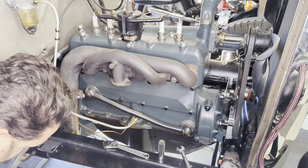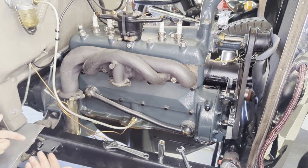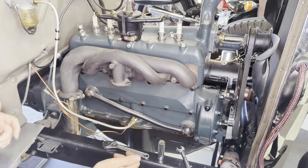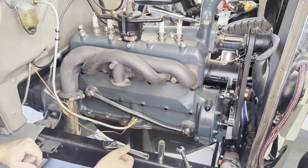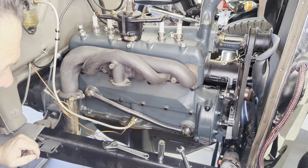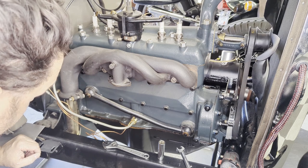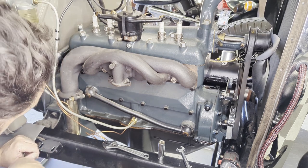I do think it's a good carburetor overall. I put new jets in it of the original size. I'm at 5,000 feet elevation here, and I think it probably could be solved with jetting, but I'm just more comfortable and familiar with the newer Weber carb, so I'm going to go that route anyway.